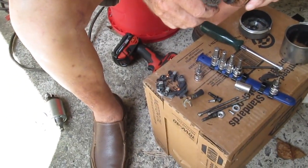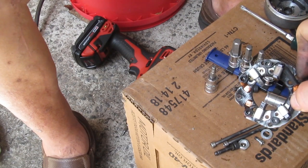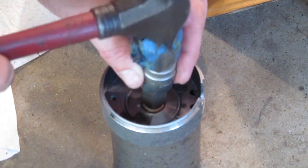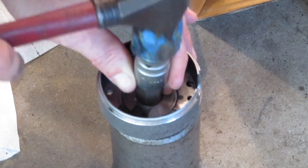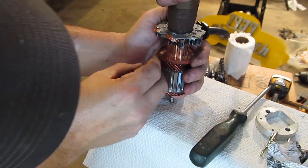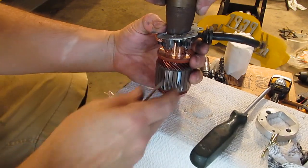We bought a kit to do this — all the electrical bits, the rotor, the brush piece, and a small brass bearing that goes behind there. I'm just going to set it in with a couple of light taps. Getting the old bearing out was a little tricky — I had to make a small prying tool — but it goes back in nice and easy. Getting the brushes over the commutator is a little fun too. We used a tool to spread them out a bit, then pull them back by their springs and get them over the lip of the commutator, and then they slip right on.